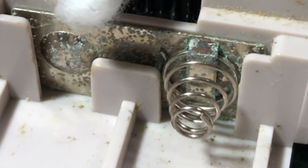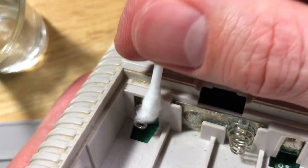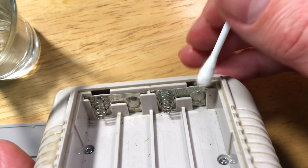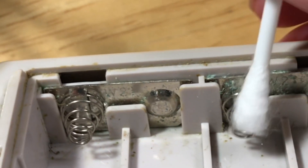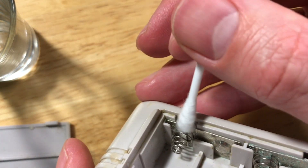Alright, so back inside here. Check it out right here — that's all battery acid corrosion on there. Coils fortunately don't look like they're too bad. And even as little as this — see this guy here, it's the flathead — if that corrosion's between the battery and the straight contact, that alone can be enough sometimes to prevent a system from working. Looking at the underside, same thing here. This one is getting to be pretty green. Again the coils are pretty stable here, but they can be cleaned up all around before they start to corrode any further.